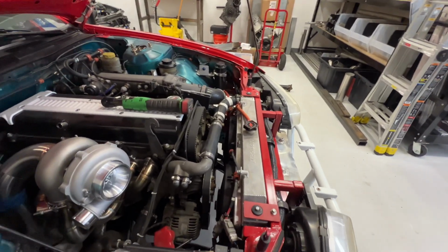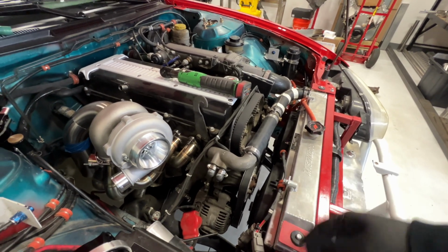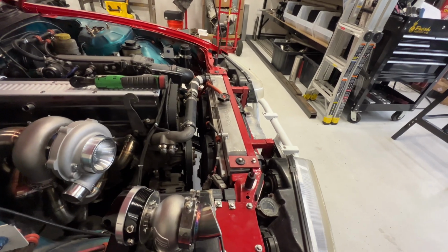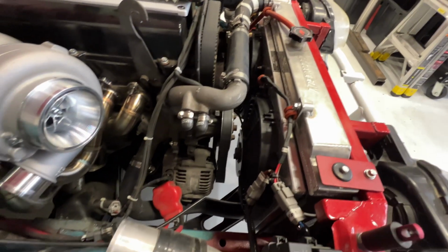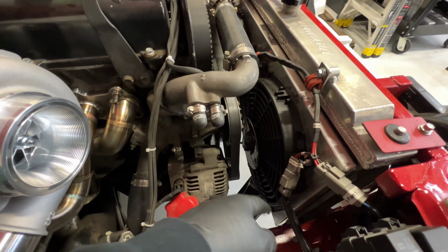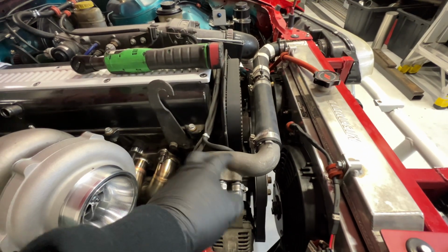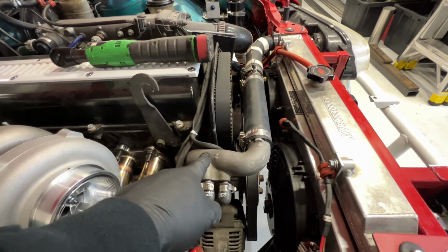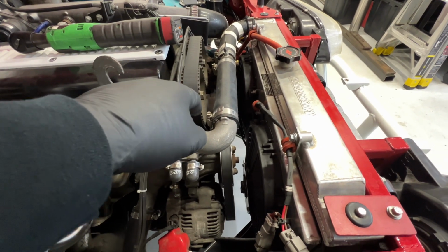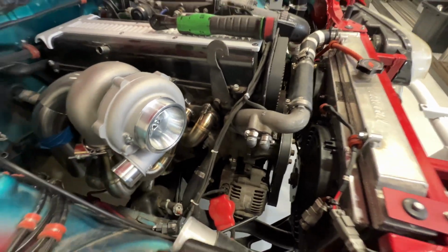And it's tanks on the side as opposed to the top. They cool better. And it's a dual pass, where this is a single pass. So the inlet and outlet are going to be on the same side. There'll be a divider in the tank. And I'm going to cut this down and do a swirl pot. And it's just going to go straight into the swirl pot, right into the radiator, out the bottom, back into the thermostat.